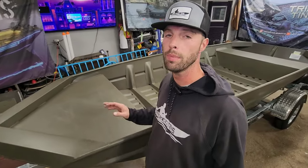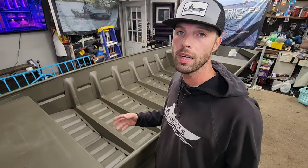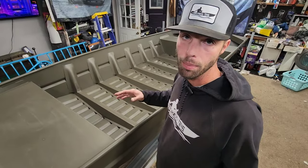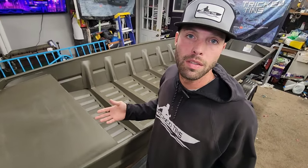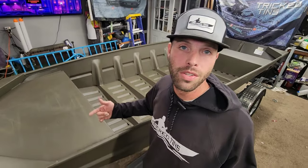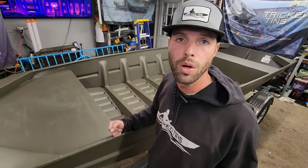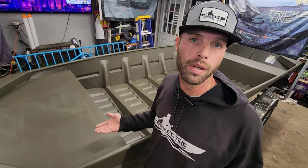That's my two cents on a jon boat — what I look for in a build. This boat is going to be sick when I build it out. A lot of guys get these and put wood floors in them, do small modifications, and then one day want me to finish it, paint it, turf it, and put decals on. If you're looking to build a lifetime boat, do it right. If you just want something to last a couple of seasons and put 500 bucks into it, go get a riveted boat. But if you want to build a trick tin that lasts a lifetime, you've got to start with a welded hull. If you get a crack, a welder can fix it — instead of having a leaky rivet you can't get to.